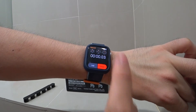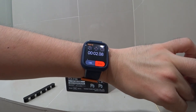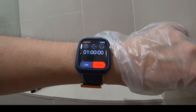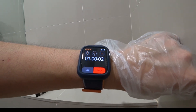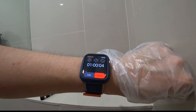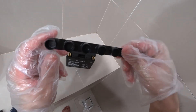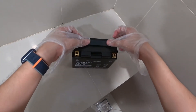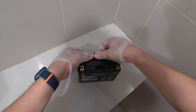As you can see, all the acid has gone into the battery. What we need to do now is give it one hour for the acid to absorb properly into the cells. Make sure you are in a well-ventilated area and don't seal the holes yet. Once the hour is complete, seal the battery by installing the seal on top — this will keep any of the solution from spilling out. Note that you're not supposed to undo the seal; it's a once-off thing.